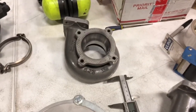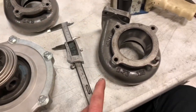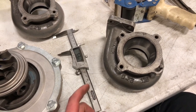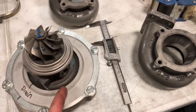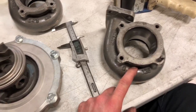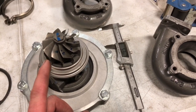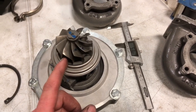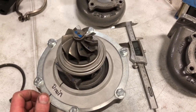What I did for this build is I took these HKS turbine housings — it's a twin turbo car — and I machined those out for this turbine wheel. Originally this one was machined for the 51mm turbine that looks identical to this, and then there's also a 55mm turbine. I pretty much always upgrade to that 55mm turbine.